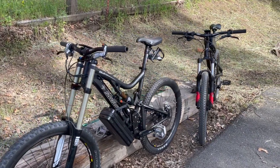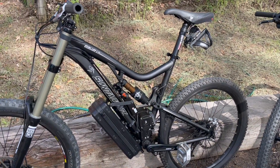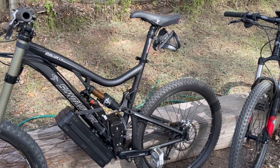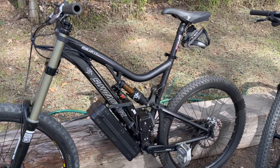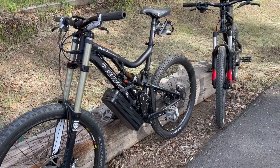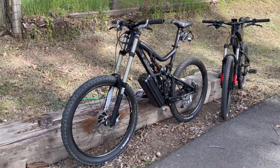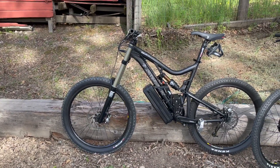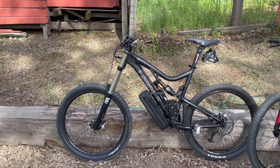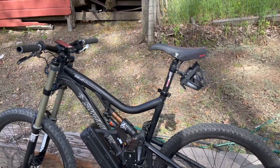On the Blur, we've done some modifications here. We've got the controller mounted off the battery pack and separated from the motor. The motor is sandwiched into the front triangle and then the battery pack has been turned on its side. CYC has a picture of one on their site and we decided to try mounting it that way. It gives us a little more clearance on the suspension and allows us to move the battery a little higher as a result.